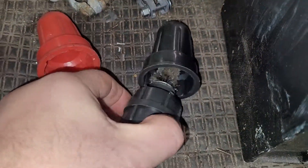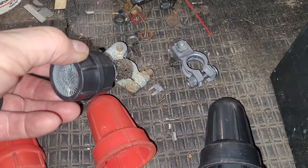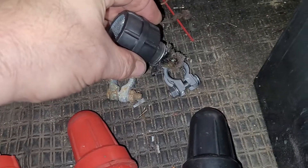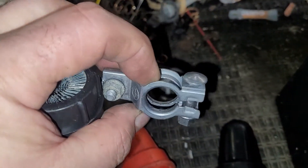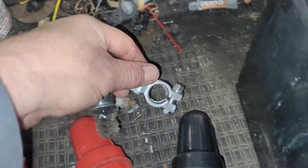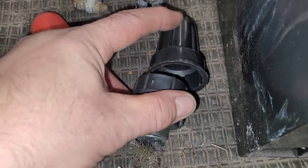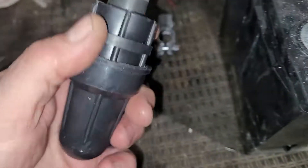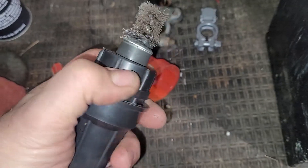Now this is the other one that I have, and it's got a brush on both ends. You're going to clean this type of terminal with this and it does a nice job because it cleans it evenly and gets all the crap out. It works great because it doesn't dig off any of the material — it just cleans off the corrosion that builds up. The nice thing too with this setup is you reverse it just like that. Now you've got a handy holder and it's a driver too, because those little splines there grab into the female splines inside the cup.